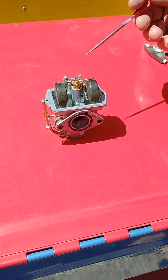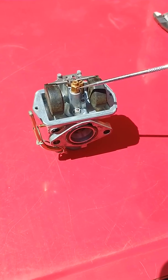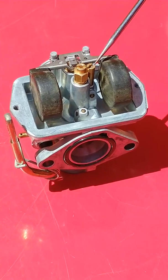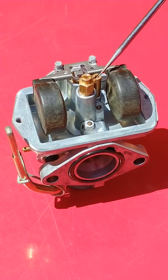There are two jets in the LO-206 carburetor. This is your main jet that screws into the top of the emulsion tube found right underneath it. This is your pilot jet. That's your idle circuit up to about half throttle, and it does include a little bit of fuel at wide open throttle, but its main purpose is from idle to half throttle.